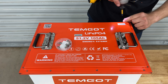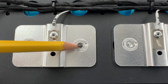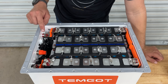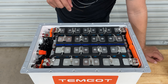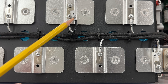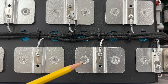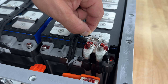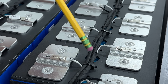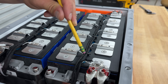Let's see what's inside. All these bus bars across the cell terminals look like laser-welded bus bars to join the two different packs — a little bit flexible with a bit of strain relief in there. Looks like all the terminals are marked with some waxy-looking goop to indicate they've been torqued down to spec — that's good to see. I don't see any soldered connections. The little tabs for all the balance leads and temperature sensors are not only riveted, but the tab itself is laser welded onto the bus bar below it. I like that combination — it's a good design for a battery in a high-vibration environment. Everything is nicely wrapped in what's almost electrical tape but abrasion resistant, and everything's cable-tied in multiple spots down to the top board with a foam layer underneath.